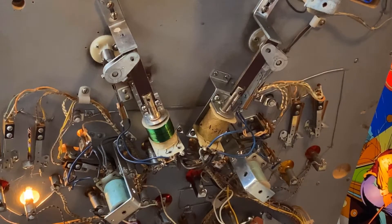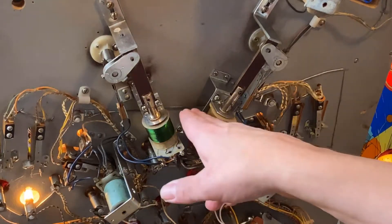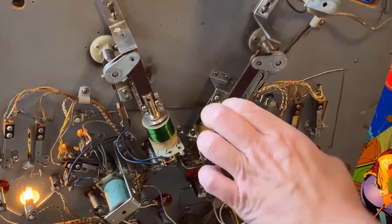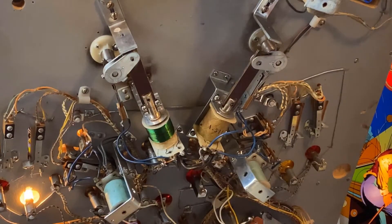So in a normal shot, the low resistance part of the coil fires. Holding the button in, the end-of-stroke switch opens up and now we've added the high resistance coil in, which provides just enough strength to hold the flipper open or up.